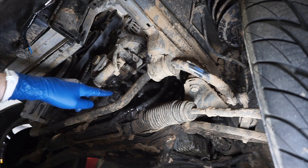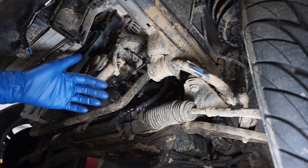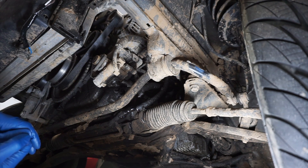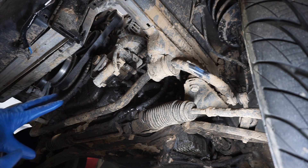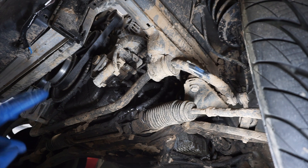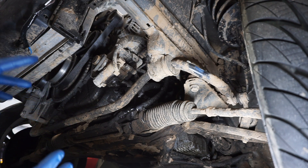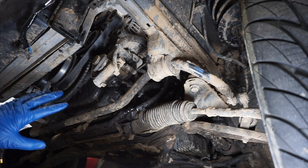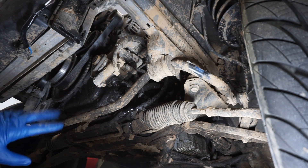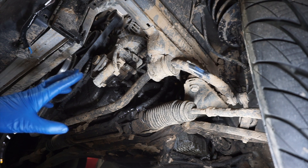When you're doing your power steering, you don't want to cut the lines like this unless you have to — I was just being lazy and didn't want to get my hands super dirty. So I cut the lines and let them drain out. This power steering fluid in the car is absolutely horrid; I've never seen anything this dark and it smells terrible. Even if we were keeping the power steering, this would have had to be drained and flushed regardless.